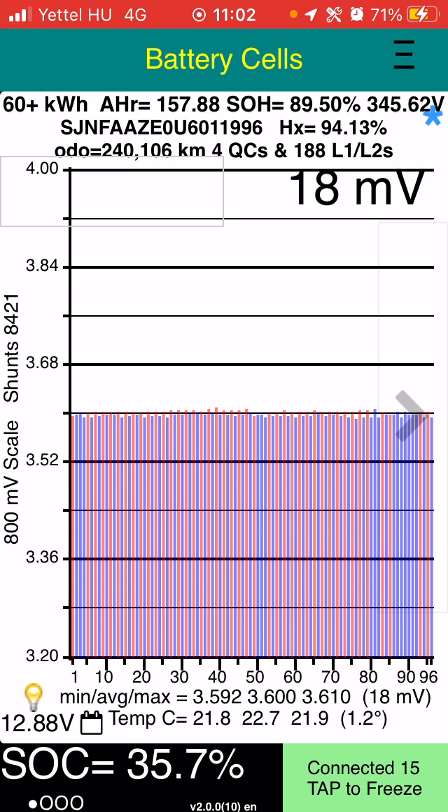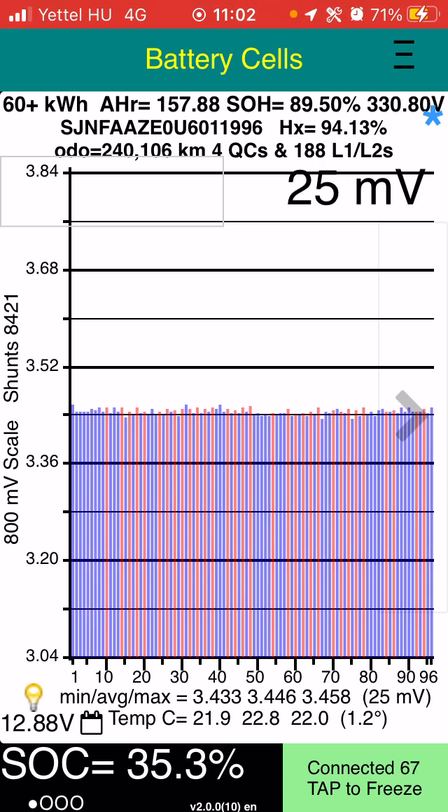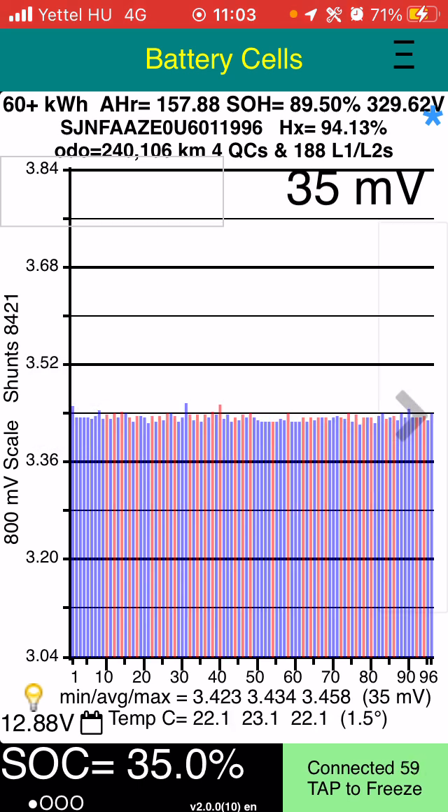You'll probably hear the noise of the motor as we go. That's full throttle — ideally for 10 seconds or more — and then you'll see that the millivolt reading will change as you go. This one peaked out at just over 43, I believe, and it's back down to 25 already, now 35.